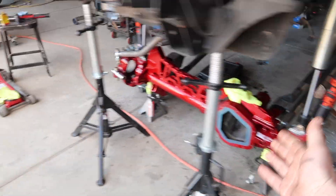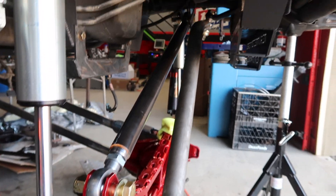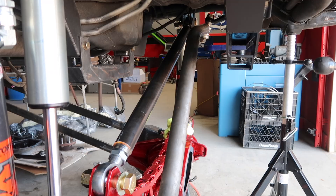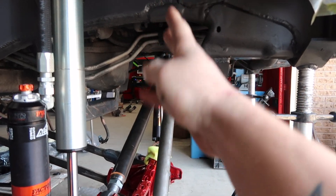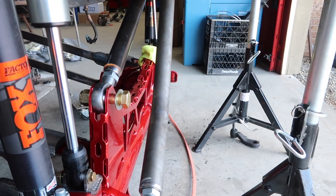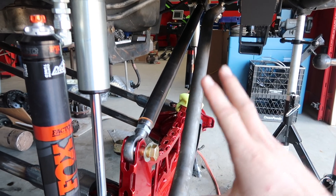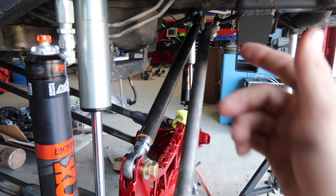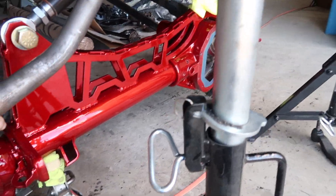So we left off getting the axles under the truck. We got the steering knuckle put on. As you can see, we got the panhard bar — this one's not tacked in yet, not built or welded or anything. I actually had to bend this one in order to get our heim joint angles okay, which is fine. Basically two points of pivot — technically both heim joints, you could do whatever you want in there and it'll never change the degree or angle of steering, unless you made the bar shorter. As long as you make it to the length you need from start to finish, it doesn't matter if it's bent or not. It's still going to steer the same and swing the same arc. It's just to clearance the heim joints so we don't bottom out our heims on the steering.